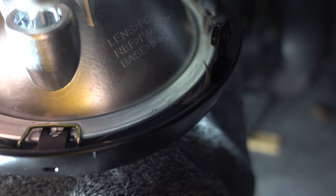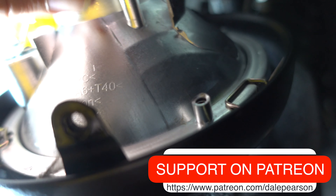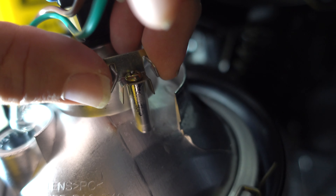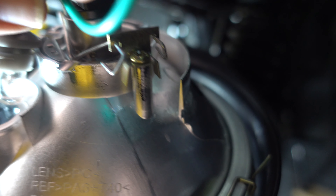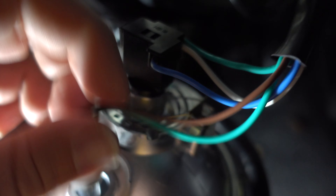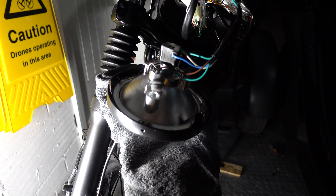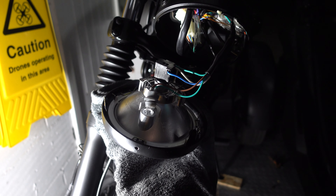When you come to change it and push it back in, you just need to apply some pressure. For the other bulb — the HS1 — there are these pronged clips on the back. You basically squeeze here and that will come off, then undo this connector. I am going to put on a rubber glove just because you don't want your fingerprints making contact with the bulb. Let me get the bulbs changed over and reconnect the cables.